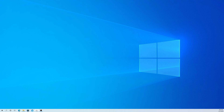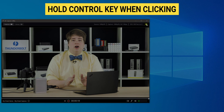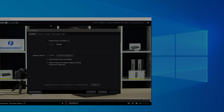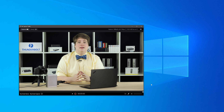Once installed, launch the software. Then, hold down the Control key on your keyboard and press the Preferences icon in the top right-hand corner of the program, highlighted here. Click on the Devices tab and on the Capture Device setting, select Camlink 4K. Then, under USB Transfer Mode, select Isochronous. Click Apply and then you're finished. The Camlink should now be compatible with all Thunderbolt 4 docks.